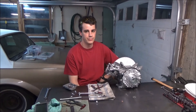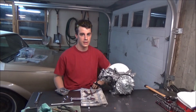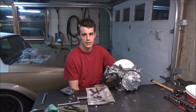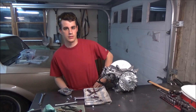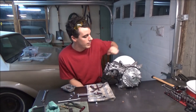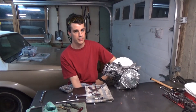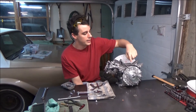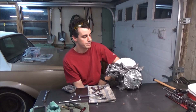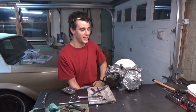It's a few days later but we're back at it. You already saw how we timed Joey's motor - the Honda clone motor. The timing needed to be advanced about five degrees because the flywheel was at 27 and needed to get to 32. These are supposed to come at 32, which is the spec for my cam. We tested it with the timing light and degree wheel and it actually came out right around 35. The issue probably isn't with ARC's flywheel - it's probably with the grind for the woodruff key on the crankshaft itself. I trust this quality American product over this motor from China which cost as much as the whole flywheel.